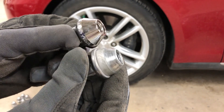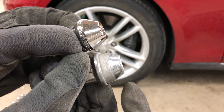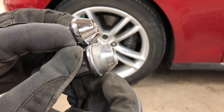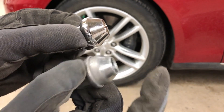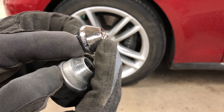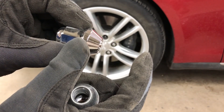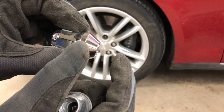These aren't stainless, so these are not going to distort as easily. If you look at the clamping surface, it has the same taper, the same angle. This one's just a slightly different style — where it kind of flattens out here, it doesn't matter because that's not contacting the wheel. It's the tapered area that holds the wheel on, and the wheel stud and the lug nut together have the clamping force.